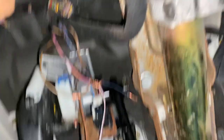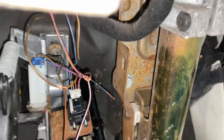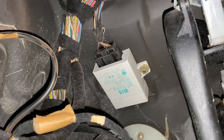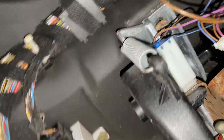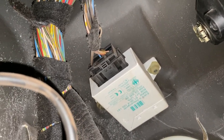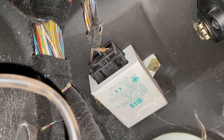I wired everything up — this is what I'd call a butcher job. It's really not pretty but it's going to work. Now all we need to do is wire these two blue signal wires to the EWS and the DME, so that's what we're going to do right now. In order to do that, you're going to have to remove this switch right here. Like I said before, you have to wire it to pin 8 on the EWS and pin 23 on the DME.